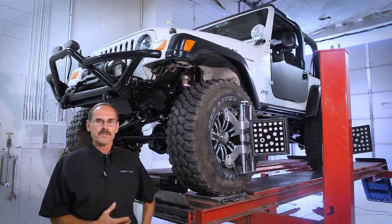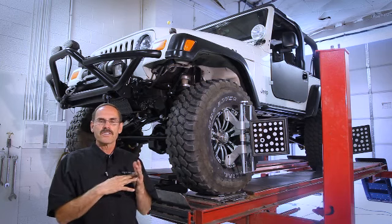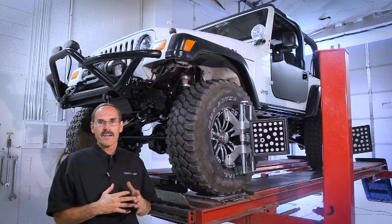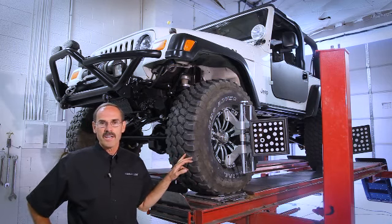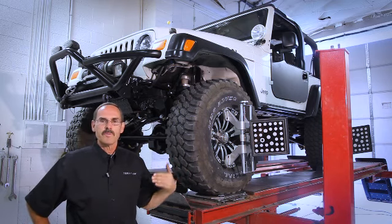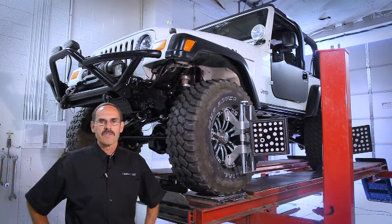We're real happy with the numbers we've pulled up with the rear. We've got it square back there, our pinion angle looks good, our thrust angle is great, but we made some huge changes to get there. That pinion we moved up about 8 degrees, our axle we moved over to the side like 4 inches. So just to make sure we're working with accurate information for what we're going to be reading on the front, let's go ahead and do a rollback, do a caster sweep, and pull up some new numbers.